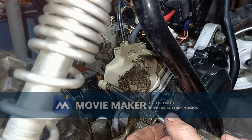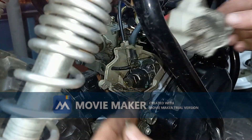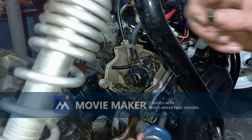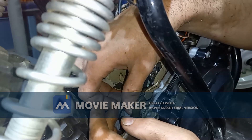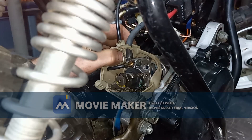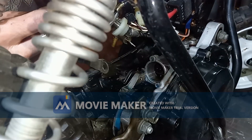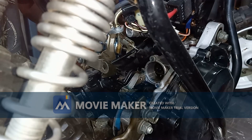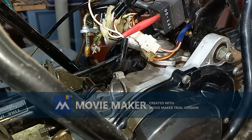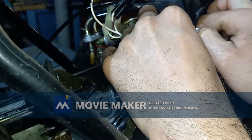We're back on the other side of the bike. We're going to pull out this screw here on the oil pump cover, then take this screw out here. Actually, there is another screw hiding down here. Now we should be able to wiggle it free — it does just take a little bit of persuasion once you get your screws out. So that is our carb and oil pump. We ended up finagling that oil pump out, and I would say that disconnecting your oil line first will keep it from looking like a Smurf crime scene. We ended up getting all that out of the way and cleaned up the oil spill.